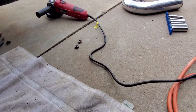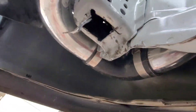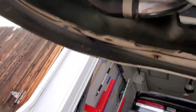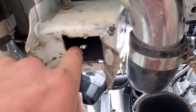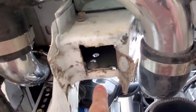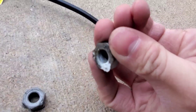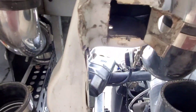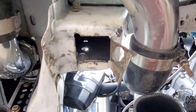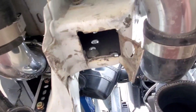Just to show you what I did here — I cut out just a little access hole and bent that back, and now I have full access in here. Actually, there's still a nut — that one's still welded, so we're good on that one. But these are the two nuts that were supposedly welded on the inside, preventing me from putting a bolt in there. Now I can go ahead and put my bolt through and put my nut on the backside and put my traction bar on.